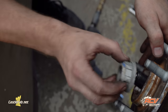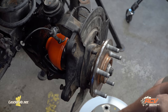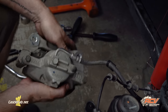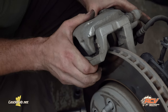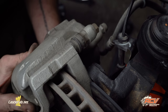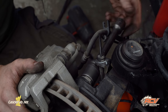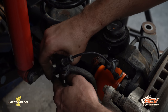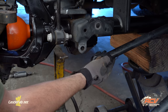Now we're ready to install the axle nut. Now it's time to install the rotor. Now that the rotor is installed, we're able to remove the caliper from the wire holder and install it on the vehicle. Reinstall the two caliper bolts — once you get both lined up, it makes it easy to install by hand, then torque to spec. Once the caliper is installed, reinstall the ABS line to the brake line with the factory clips. Now that the RCV axles are installed and brakes are back on, we're going to reinstall the track bar.